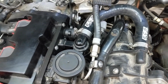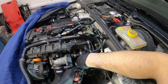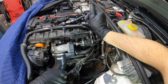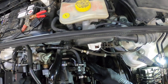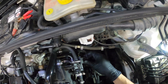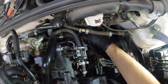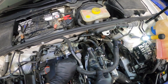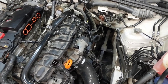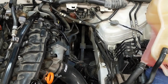I'm going to try to remove this without breaking anything further — I already did snap the clip on the bottom maybe a year ago — and I'm going to try to remove as few items as possible to get at this hose. [works on car] I did it! So that took about 25 minutes and was actually pretty annoying — a little bit more annoying than even I thought. What I ended up doing was just moving the coolant expansion tank — you can just take it out of those two tabs. You need the head and arm space to see what you're doing.